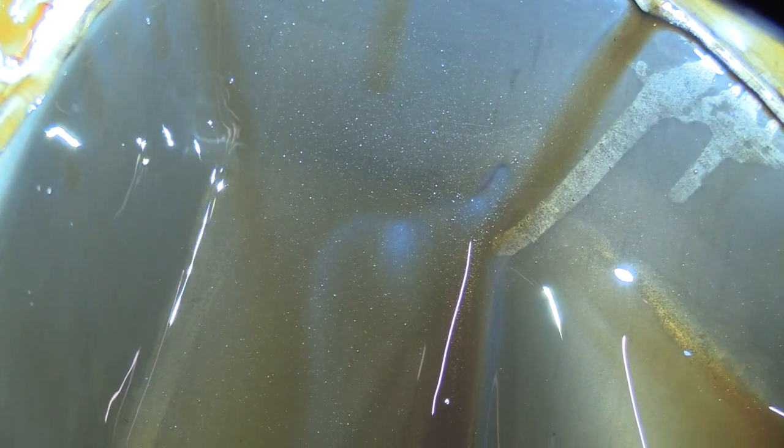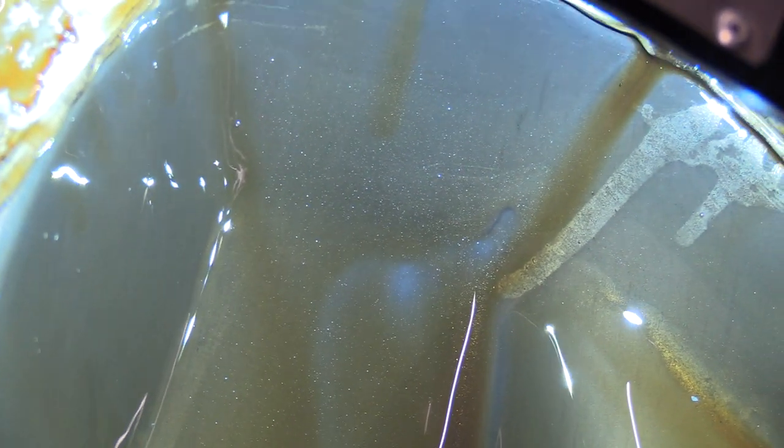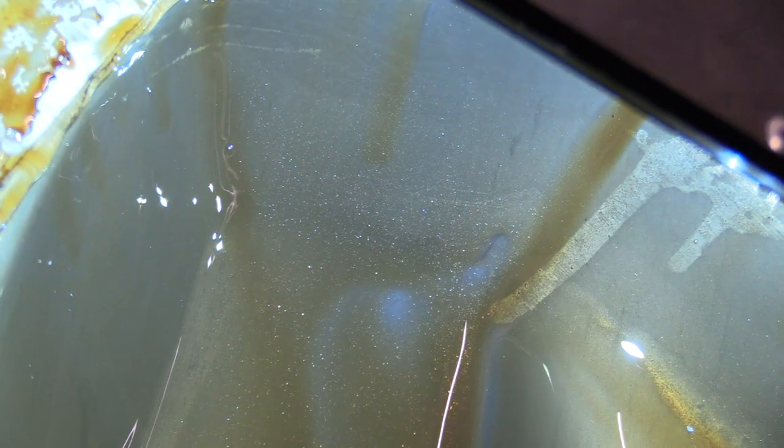Here's the cover out in the light so you can see what we're talking about. In that first 15 to 20,000 miles, there's a lot of breaking-in going on in the differential — everything's getting mated as far as the gears. If you look in here, you can see all those sparklies floating in the oil throughout. Those sparklies are the metal I'm talking about. You've seen how much metal is on that magnet, and once that magnet gets loaded up, it doesn't have the same pulling ability. This real fine stuff keeps going through your bearings over and over and bruises them. Those particles are at least 40 microns in diameter, while the oil film thickness in those bearings is one micron or less — so this stuff is going to do damage over time. That's why we need to get it out of the differential.